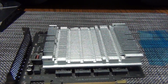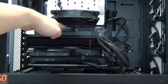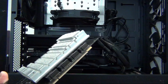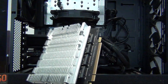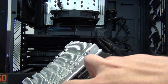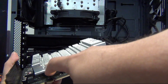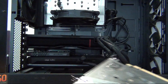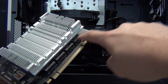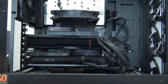To install this in the PC, you're going to need an X16 slot. The top slot is always X16 for pretty much every motherboard that has a full X16 physical slot — normally the graphics card goes there. So if you want to use four NVMe drives in a regular consumer desktop like a Ryzen or Intel Core build, you will need to use your graphics card slot and move your graphics card down to an X8 or X4. If you want all four drives detected, each requires four lanes — so that's 4, 8, 12, 16: you need 16 lanes. If I plug this into my capture card slot, which is an X4, only the first drive will be detected. The other three will be invisible — not enough lanes on that slot.